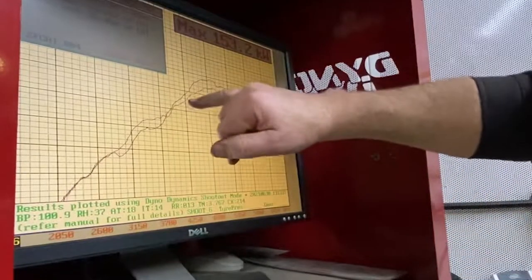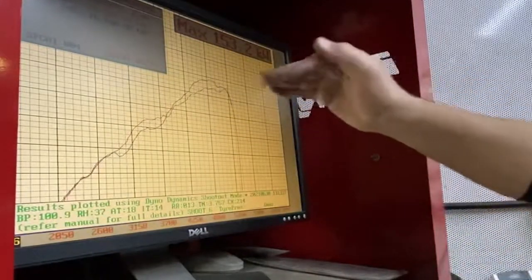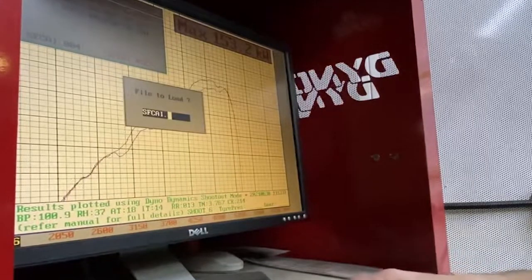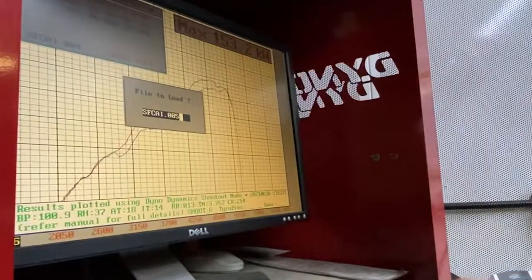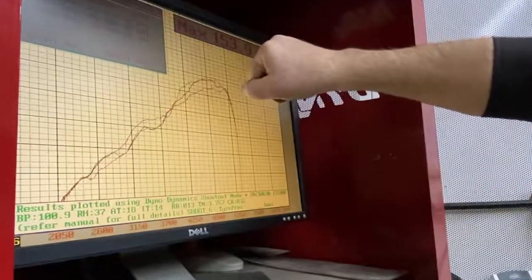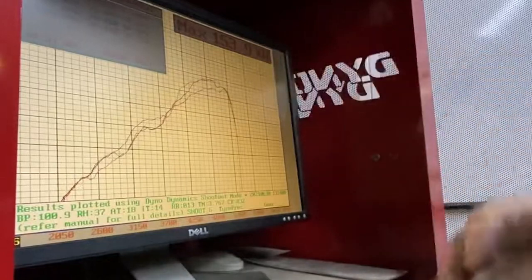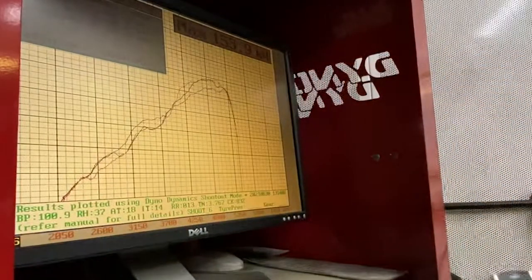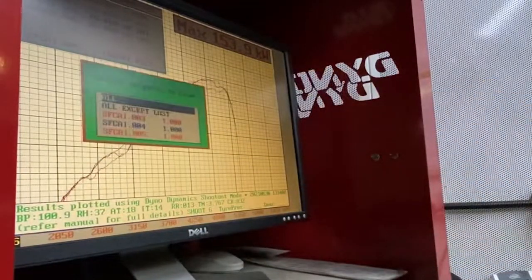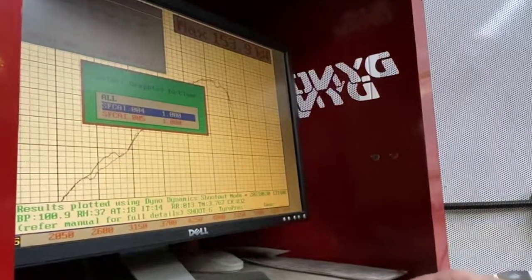004, oop, back one, 004. Okay, that just through heat in itself achieved another few kilowatts. You can see why we do some stabilization runs. And 005, it's stabilized, there you can see it, at around 153.9. The last two runs, the second and third runs, on the standard airbox at 154 kilowatt, we can call that. So we'll just leave that last one, which was the highest. Let's get rid of the others. Okay, there you go.